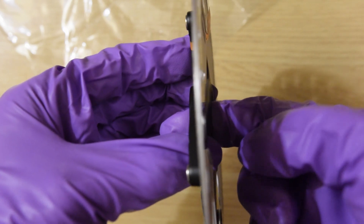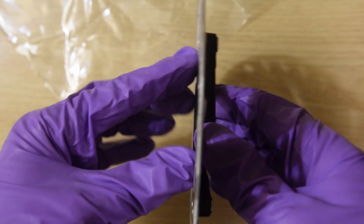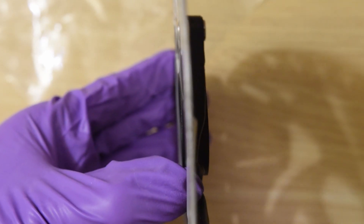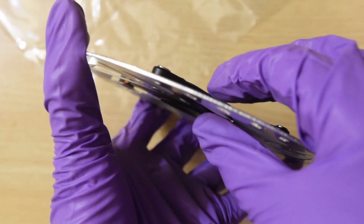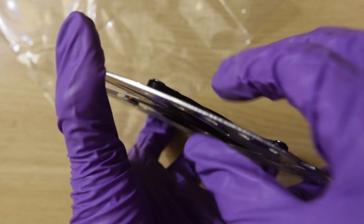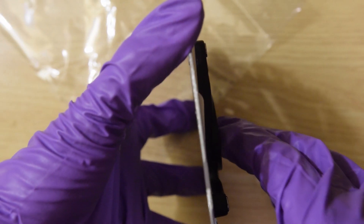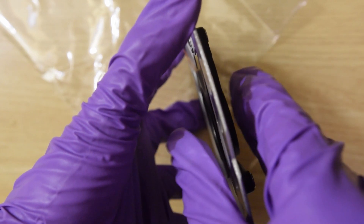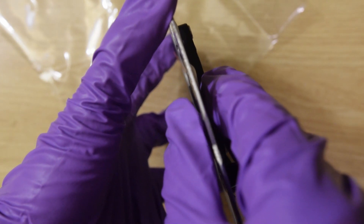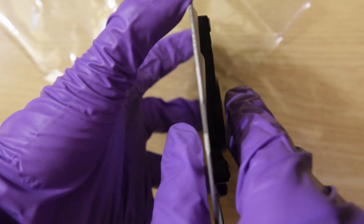Because it's recessed on the left side, and the disc forks are on the left side of the bike, you can see that it does stick out just a little bit. The other thing I want to check is if this rotor floats. If I push it back and forth, I can't feel a float — I can't feel the center part separate from the rotor. That's important for hydraulic disc brakes, because a floating disc rotor can move just a fraction of a millimeter to prevent rubbing.